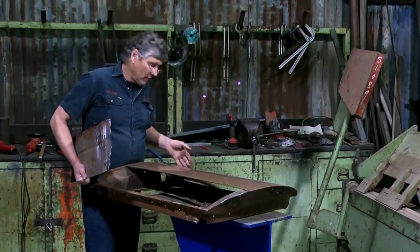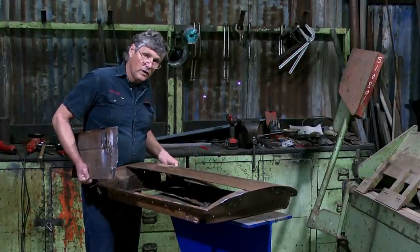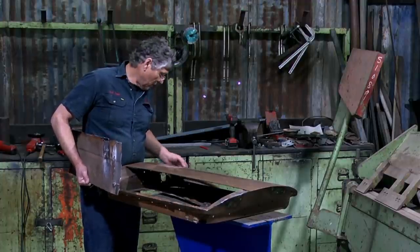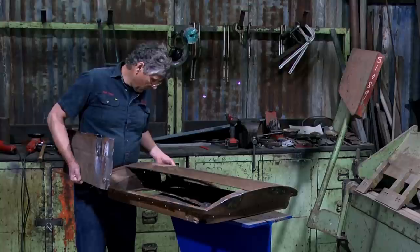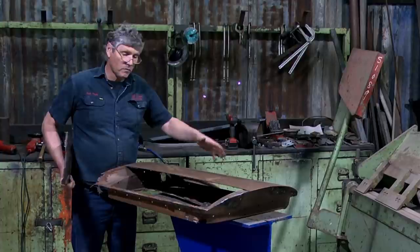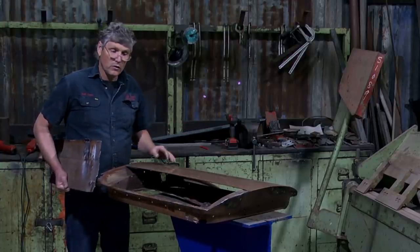At the very least, when it comes time to putting the mouldings on, put a good quality sealant in there with the little plastic clip before you put the screw in there. Wipe off any excess and then you'll know that the moisture can't start creeping down this seam and rusting your door away again. We'll definitely take this skin off completely, but we're going to weld it on the bottom first and then look at doing that later.